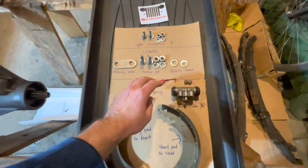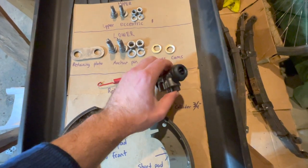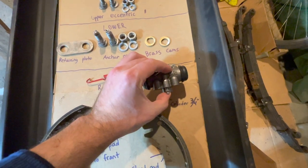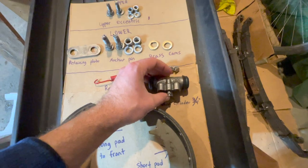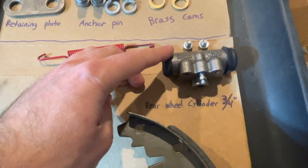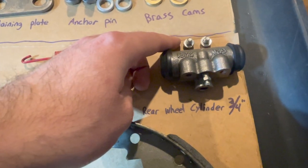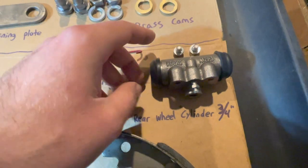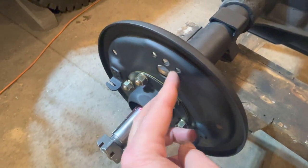Moving up the parts board, we have the rear wheel cylinder — this is your three-quarter inch bore, meaning a three-quarter inch diameter where your brake fluid is. I do have a video on how to rebuild your wheel cylinder; click the link above. To install the rear wheel cylinder there will be two bolts — quarter inch, three-eighths long, coarse thread with lock washers — and these bolts will secure the wheel cylinder to the brake backing plate through the holes at the very top.